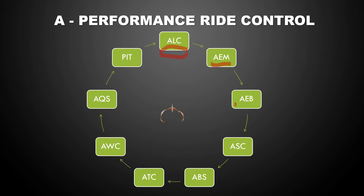The next parameter you can adjust is engine braking. I usually set this at two — it ranges from one to three. On the track, I almost never use the rear brake. Instead, as I approach a corner, I use my front brakes. I drop a gear and then I allow the engine brake to scrub more speed to allow me to tip into the corner.